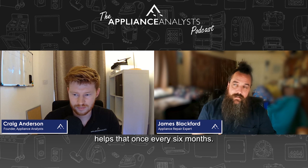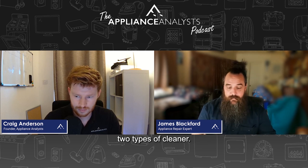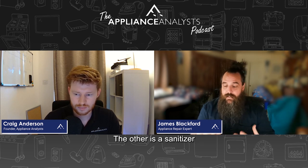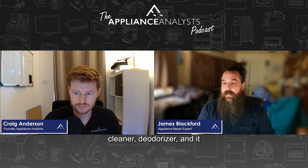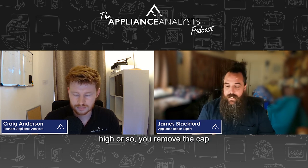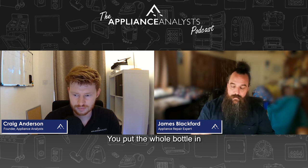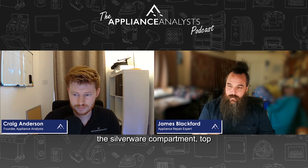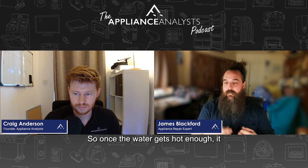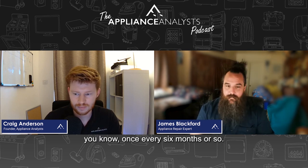Once every 6 months, I would also recommend sanitizing the dishwasher. You'll typically find two types of cleaner. One is generally the tablets that you use once a month. The other is a sanitizer, cleaner, deodorizer, and it usually comes in a bottle, maybe about 6 inches high or so. You remove the cap and there's a wax seal on it. You put the whole bottle in your dishwasher, usually in the silverware compartment, top down, and run the full cycle. Once the water gets hot enough, it melts the seal and runs the solution through the dishwasher. And that's once every 6 months or so.